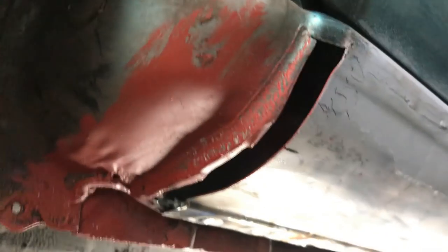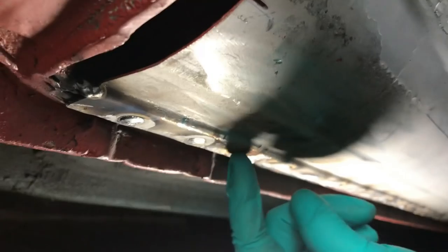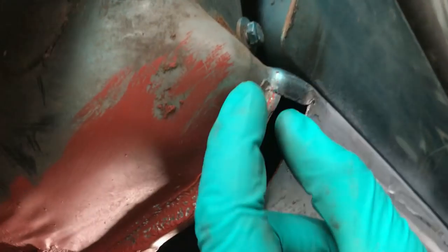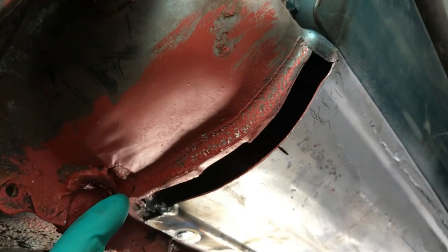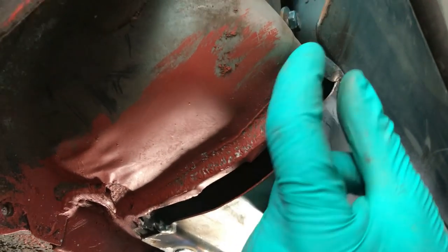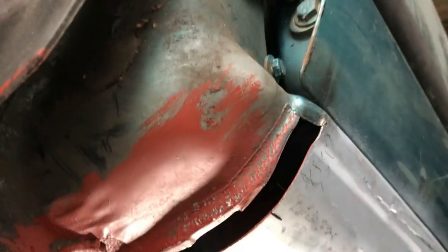Towards the end I did actually start cleaning off the bonder primer just because I thought I might as well - scrubbing it with the end of a chisel to make sure there was nice clean metal for the MIG to strike onto. Now I'm going to make the closing strip for here, which shouldn't be too difficult. I'm also going to make it a little bit deeper just so that it fits with the wing nicely. So that's my front end of wing back on its mountings - just a little M6 bolt down there.